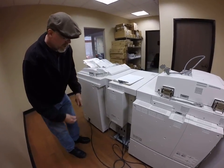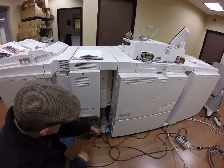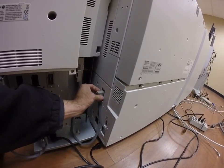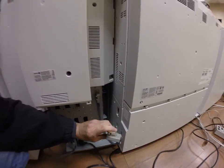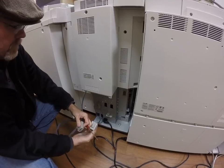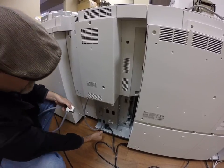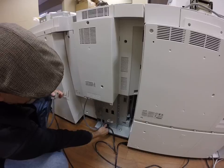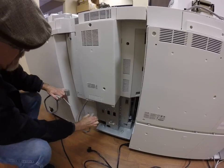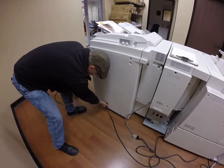Over here you'll notice the same types of connectors. This is the back side of the other side of the printer, where the power comes in. We're going to remove the power and remove the data cable — it has a depression on the other side which you couldn't see, but it's there. I've actually removed the cover, which normally sits here, to show you where the power cord comes in into the interface module. We'll remove its power right here and a data cable right here which leads into the finisher. I'm also going to remove the power to the finisher now.